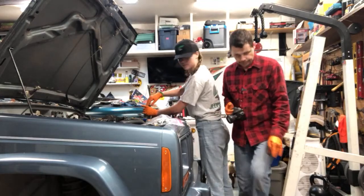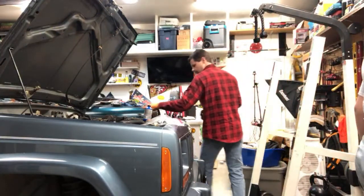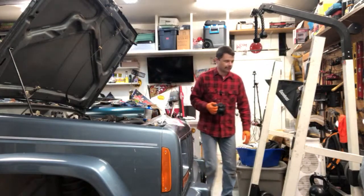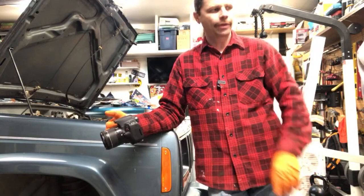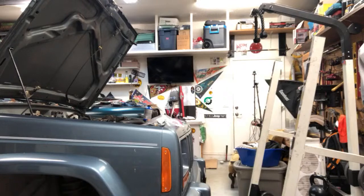Okay. All right, so let's do that a few more times. You checking the live chat? Someone said, hey Dale, to keep those bubbles from running back into the cylinder, move the bottle a little above the drum. Yeah, it's a good idea to have a little loop up there, which, let me see if we have enough room. There's no good place to, I guess I could put the bottle up on the leaf spring. Will it sit up there? Yeah, it'll just barely reach up there. Yeah. But that is a good point.